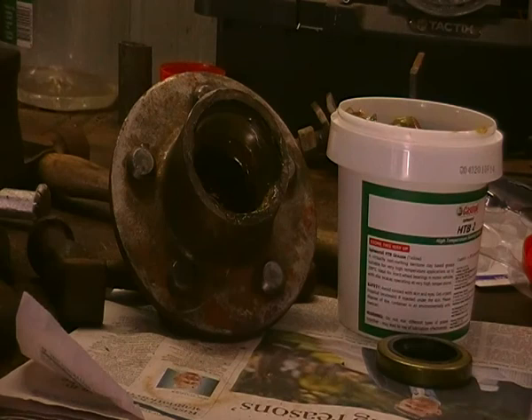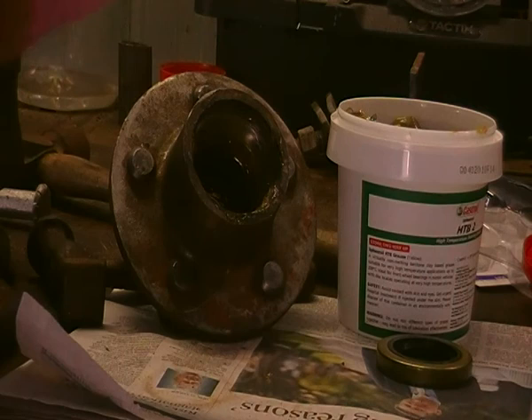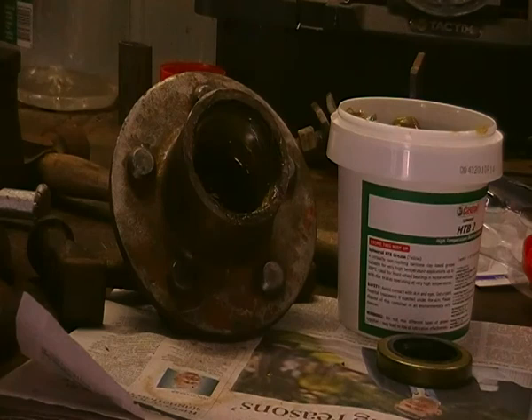In this case it isn't going to work — yes it will, it's turning. That's what you want it to do — get in there and coat the bearing. See how that's going around there. Keep putting some grease on it, take the grease in around it like that. Very messy but it's quite effective. I've been doing it this way for ages — used to do it in the garage with a packer. But you can find you can do it this way quite easily.